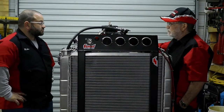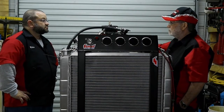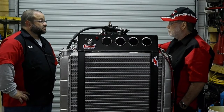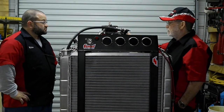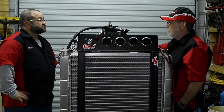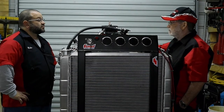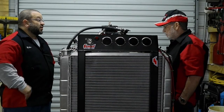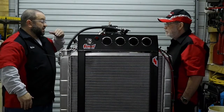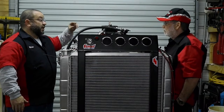This is the whole key to making sure you're not leaning the motor too lean or getting it too rich. I recommend anybody building an engine stand who's going to test motors to have this capability. Even if you're running injected or carbureted, it doesn't matter — just make sure you get the O2 wideband on there to get the right air/fuel ratio.